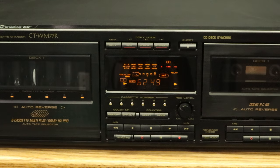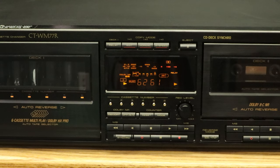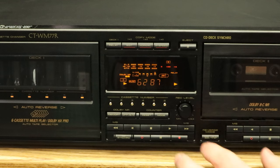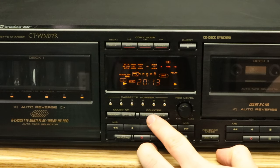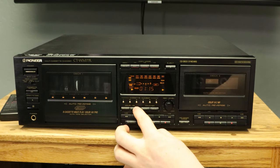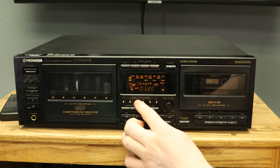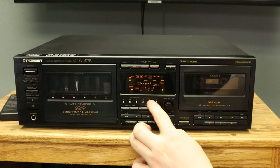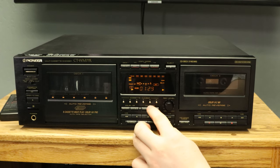Below the screen is the cassette slot selector. To the right is the recording level knob — you'll want the decibel meter to go into the red every once in a while. To the left is the counter mode button, used to toggle the time display between the standard counter and minutes/seconds. The reset button will set the counter to zero. Next are the Dolby noise reduction buttons — you can set it to off, B, or C. The memory button lets you preset every slot individually. Dolby noise reduction is basically a filter for optimizing music during playback or recording.